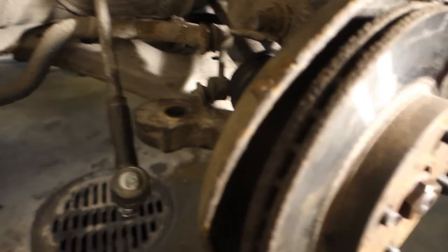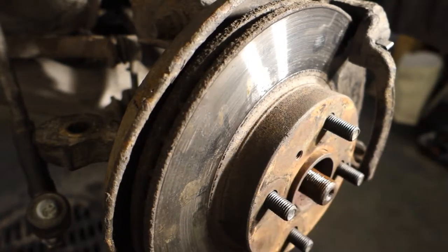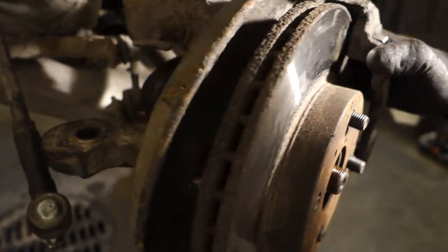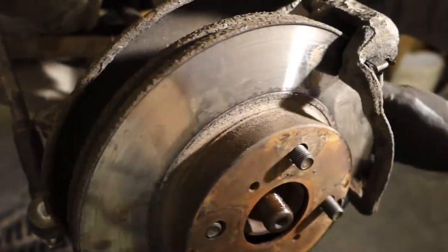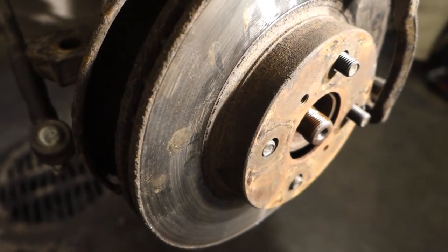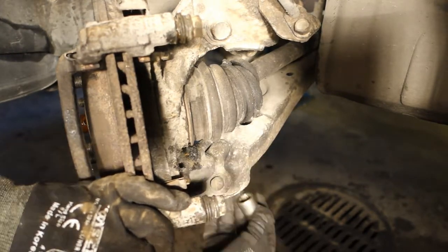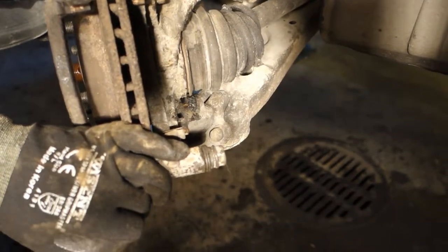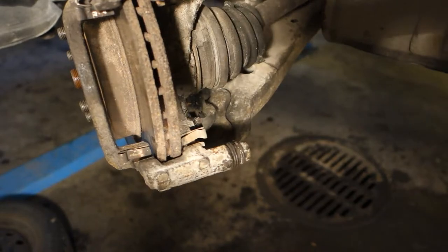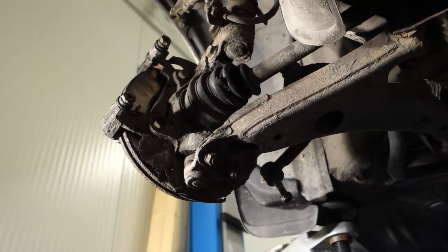And then I can open this central nut. Now I think that our drive shaft is quite free, and actually because now it doesn't open, I need to open this ball joint in this lower area next. Okay, and then I need to open this ball joint, what is in here lower, with a 17 millimeter socket and 3 bolts in here, what I open in here down, and then we look at those bolts in a little bit lower view. Okay, and here are those bolts, 3 of those, and next I need to open those.